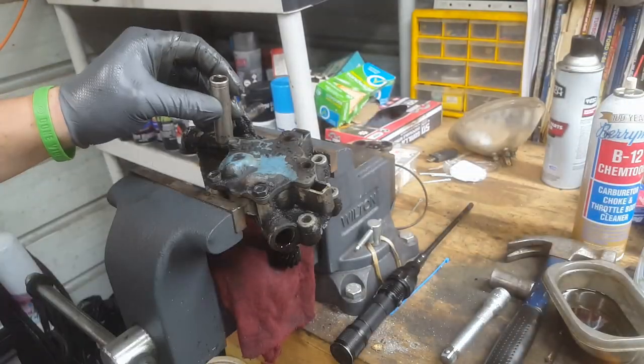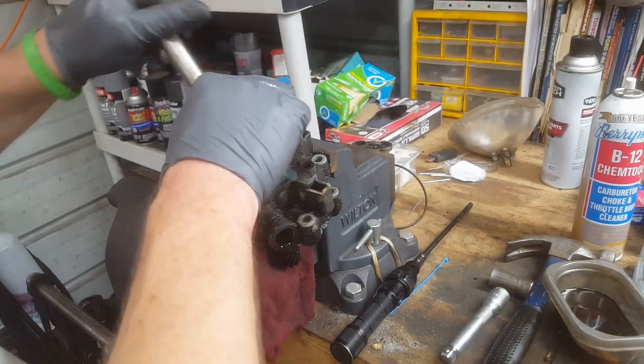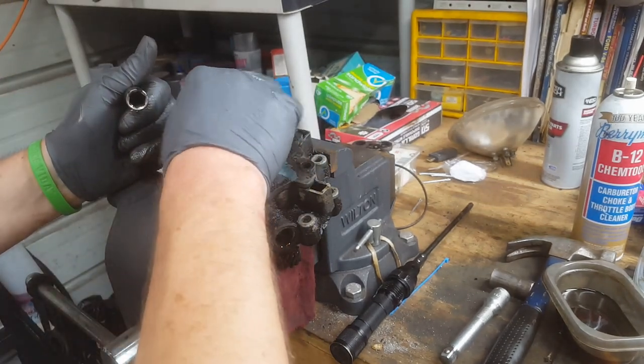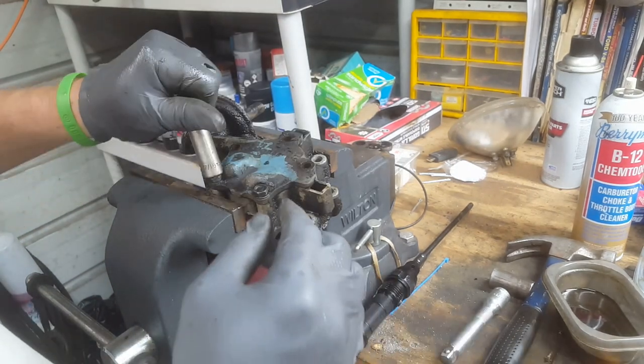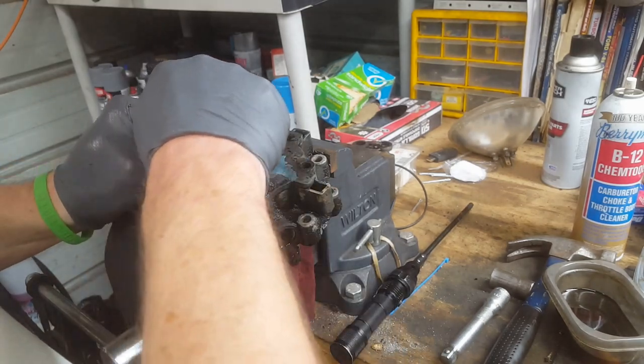You know, this thing isn't going to make any difference. It's going to make a bit of difference. Still going to have low oil pressure. It's pretty good, you know, when you get the engine revved up, the oil pressure is good. I would say good, it's 35, 40 pounds, but when it's hot, it just goes away to nothing.